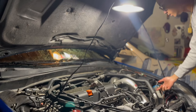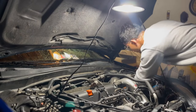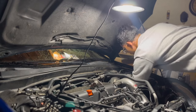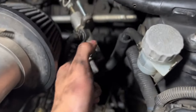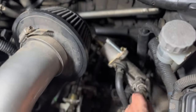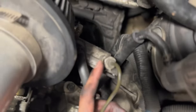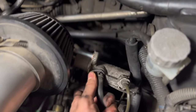Once you've completed loosening all the bolts and handling the inside of the car for the CMC, you're gonna pull it out now. It shouldn't be too hard. I successfully got it out. What you want to do from here is unplug this — I'm going to loosen this so it can come loose, because when you pull it back it's stuck on there. Then after you loosen this, unloosen this right here — I believe this is a 14 and this is a 10 millimeter. Just loosen these two and take this hose out.